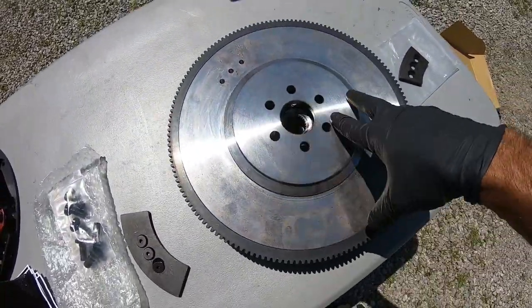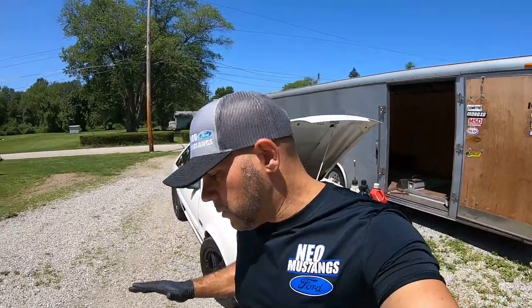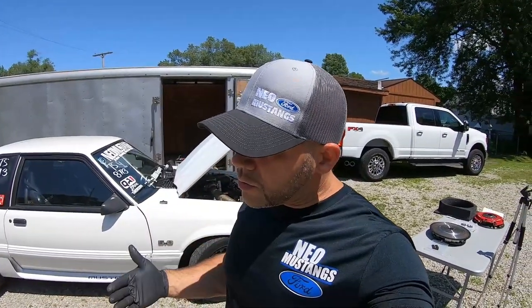I'm pretty impressed with what's going on here. In a Fox body — they only weigh about 3,000 pounds to begin with — some people say they don't need a twin disc if they only make 300 horsepower. But pedal effort on twin discs is where it's at. You'll always get the strength and the grip that you need. You just have to make sure your transmission and axle are upgraded to match. Twin discs, even though they're expensive, are definitely worth investing in — especially if you're considering other aftermarket parts on your car.